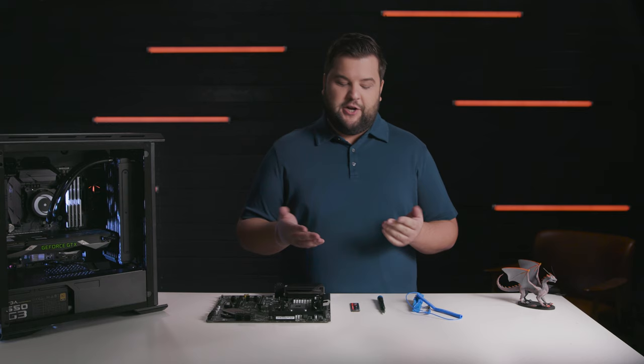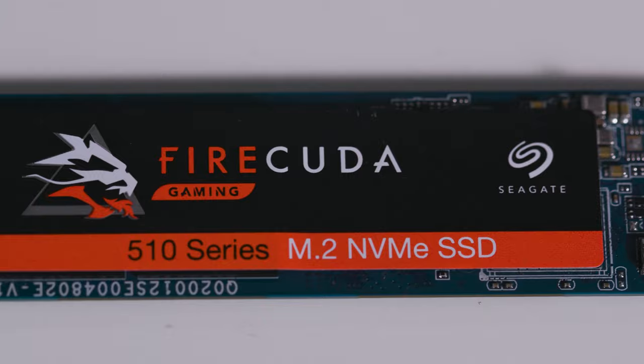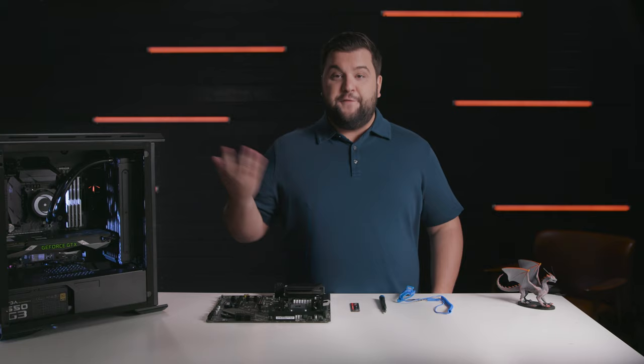When handling the SSD, make sure you ground yourself first and don't remove the drive from its casing until you're ready to install it. If you can get a de-static bracelet like this one, even better, static can actually damage your drive.